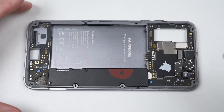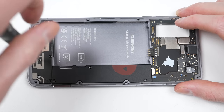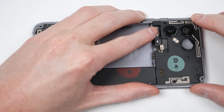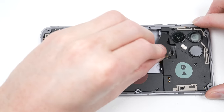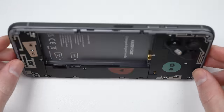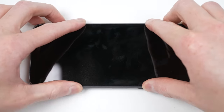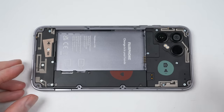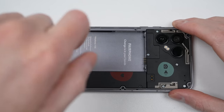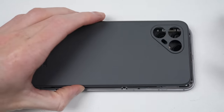It's time to reassemble — a process so easy just about anybody could do it. There's no glue to reapply or a crazy number of screws to install. Typical repairs like the display, cameras or charging port only take a few minutes. You could replace every part of this phone in the time it would take to heat up the adhesive to even open an iPhone or Samsung. With the internals installed, the screen can be fitted with the heart of the phone still intact — once its flex cable is attached, simply press it down and add the eight Phillips screws.